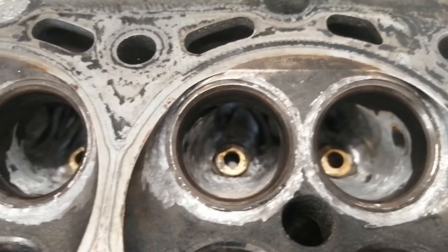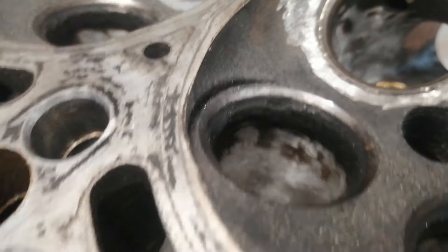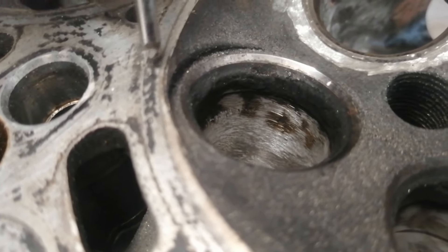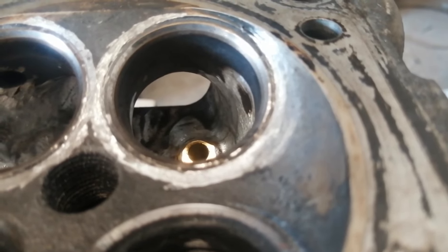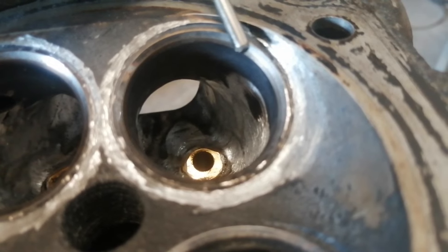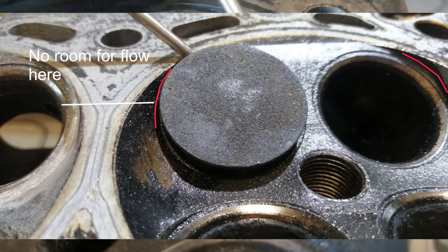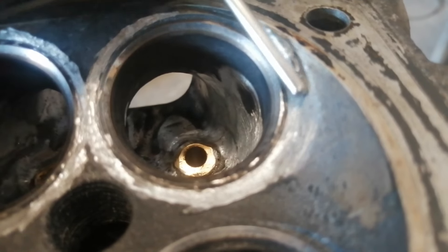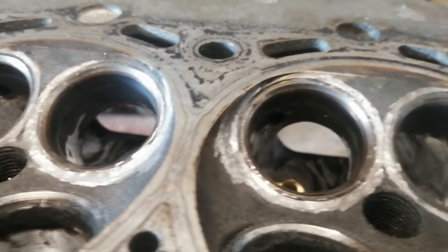When it comes to the chamber, I played a little bit with it, because there was a ridge at the intake side similar to the one at the exhaust port. This is the exhaust port — you can see there is a ton of material I've actually removed, so the valve can flow from small valve lift. Because if you lift the intake valve one, two, three millimeters, with the stock chamber design it really cannot flow towards here. The chamber is really preventing it, so maybe 10% more of the valve is cleared and it can flow more efficiently.